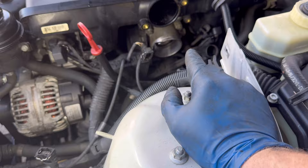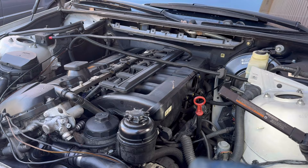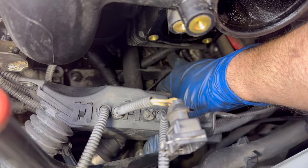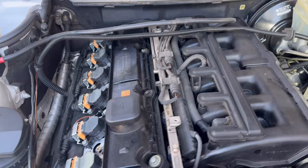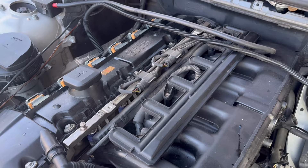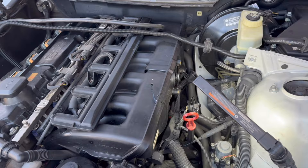We've got four bolts to take off the throttle body — let's pop it off. We've got the throttle body off. Looks in pretty good shape — a little carbon deposit on the inside but not real bad; we'll clean it up with some brake clean. There's a bolt down here that's the bottom support for the intake. Then we need to disconnect the power feed that goes down to the starter. It's dealer's choice what you do with the fuel rail — I generally pop the rail off the injectors. There's also a quick disconnect on the back of the firewall.